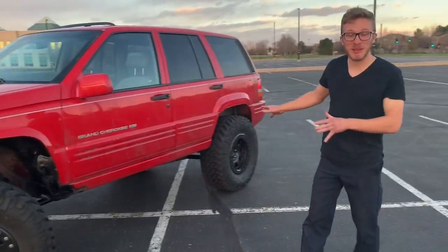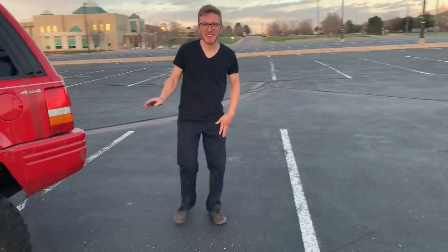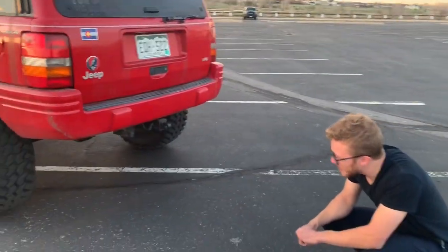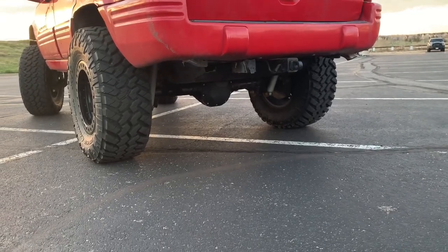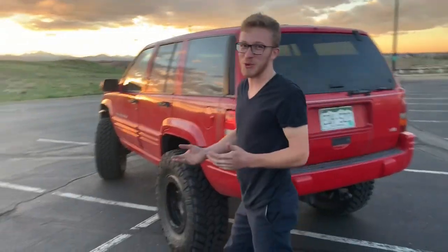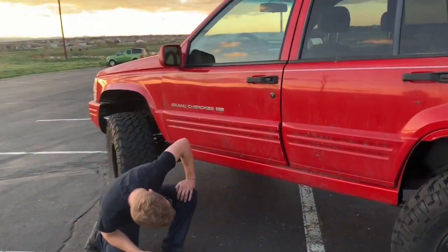In the back, we have many improvements. This is a V8 Grand Cherokee. In the back, instead of the Dana 44A which came on this vehicle, is a Ford 8.8 rear end. Which is still not great, but it's better than what came on it. It has a steel carrier section versus aluminum. And that aluminum is reserved for communists and bastards.